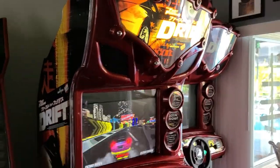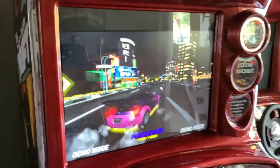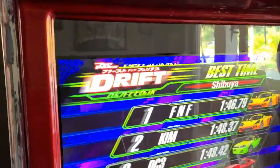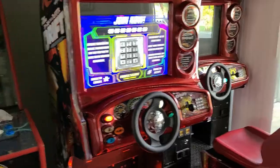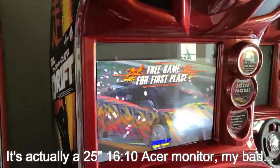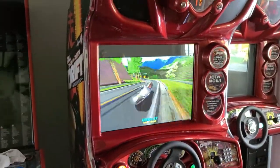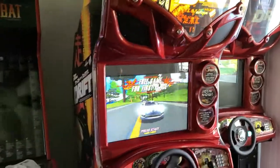Okay here we have it — final end product. We have our plexi, everything. Sorry about the glare on the screen but I can assure you the display looks super bright and super nice. I've got about two inches, maybe two and a quarter inches, of a black bezel up at the top — that's all I had to sacrifice. Everything is buttoned up in the back, ready to shove up against the wall. I'm going to do the other monitor as soon as I have a minute. This is a 16:10 ratio Acer monitor, so you get a little bit more height. Most of the time when people do this they have a black bezel on the bottom too, so you lose inches on both top and bottom. But if you go with a 16:10 ratio instead of 16:9 you get a taller screen — and this is a 25-inch 16:10 ratio.